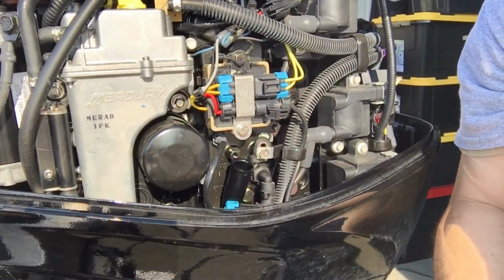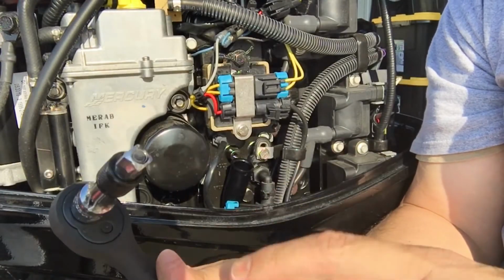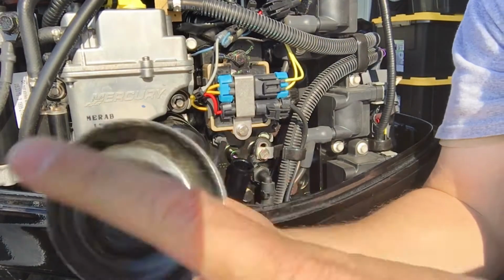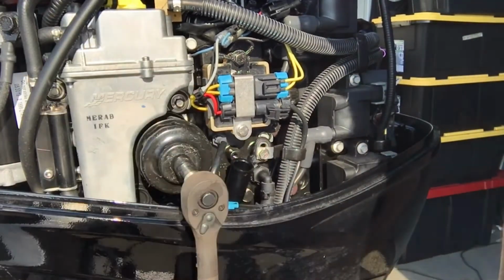And I actually didn't show these earlier, but you do need them with your oil filter wrench. It's a 3/8 socket or 3/8 ratchet and a 3/8 extension. Well, the extension you don't need, but I just thought it would be easier for this. And you stick it on there kind of like so, and now we are going to try to loosen this. Aha, see, we've made a mistake.